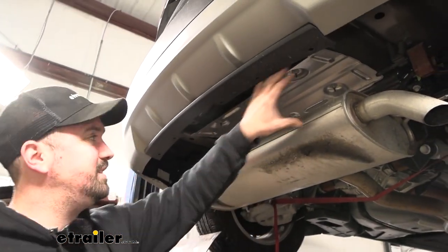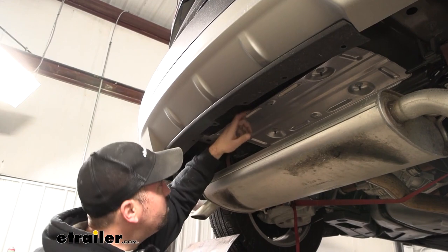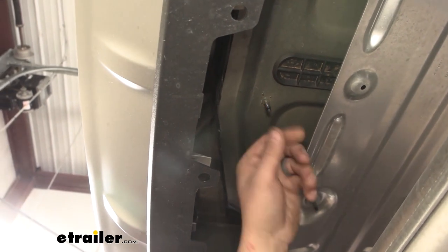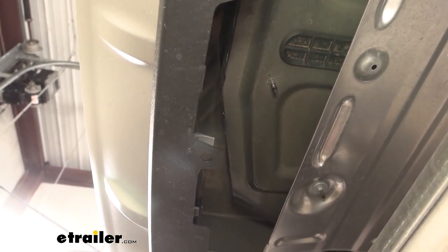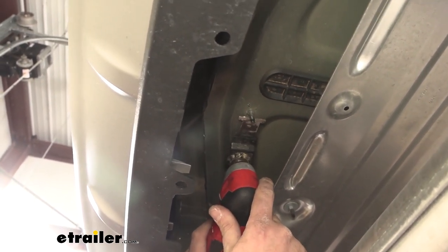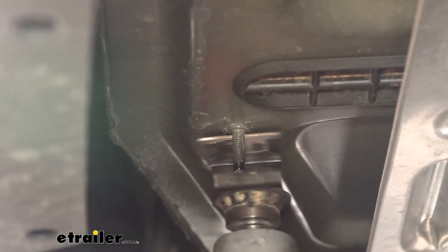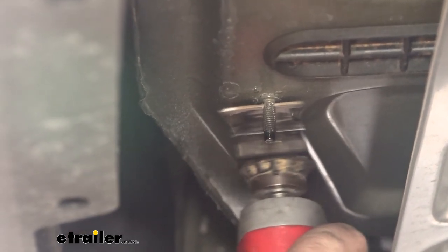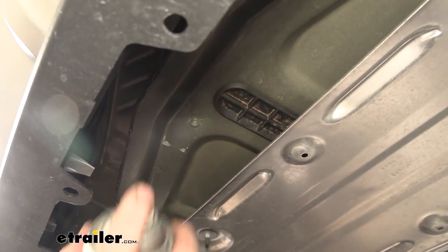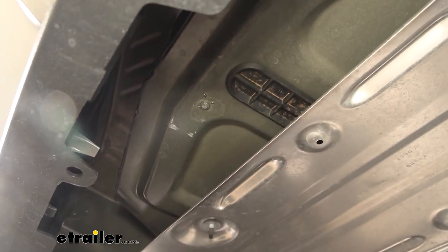Your vehicle may or may not have a plastic panel with a heat shield on the back side. If that's the case, you're going to want to pop that off. One of the points where it mounts is going to be this stud — ours didn't have the panel but the stud is still here, so we need to cut this off to give us clearance for our hitch. A dremel will work fine; I just have a multi-tool with a metal blade, so we'll get this cut off nice and flush. For extra protection, since that's going to be raw metal, I'm just going to do a little spray of clear coat on there to keep that raw metal from corroding and rusting long term.